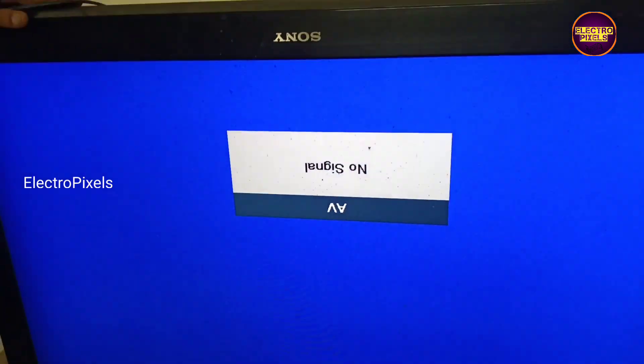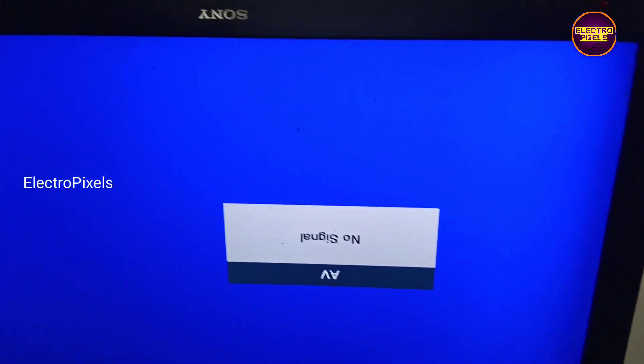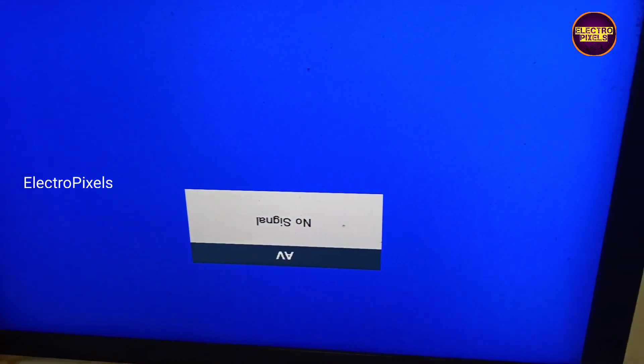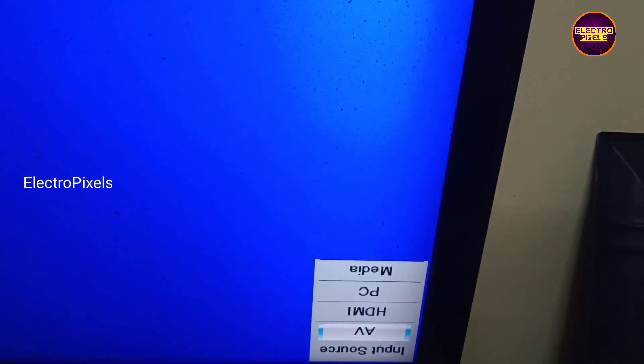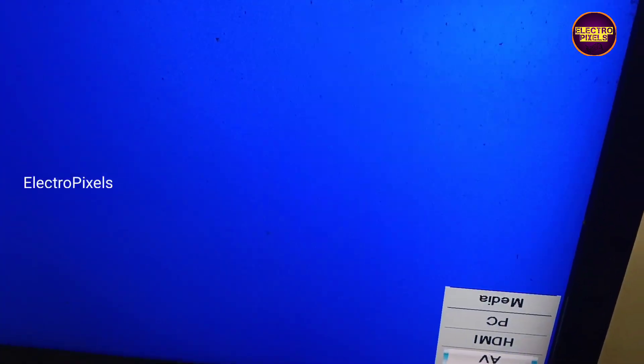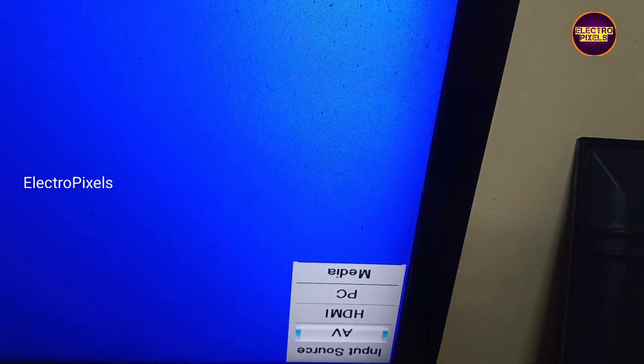While checking, the display comes on and the TV is crystal clear. By default, the resolution and LVDS mapping is correct. But to enable auto power on and to set the logo, we need to enter into service mode. The code for entering service mode is: press Input, then 208 on the remote.